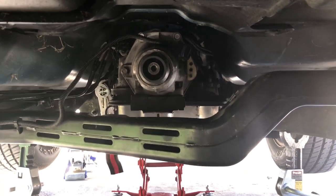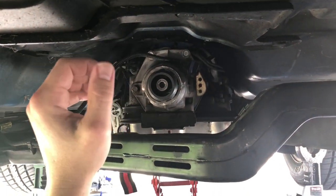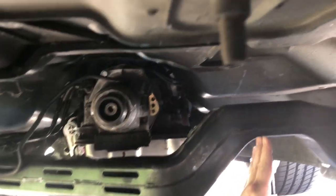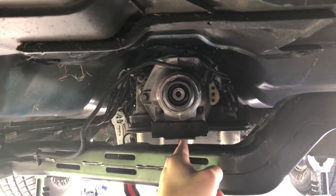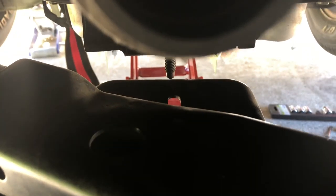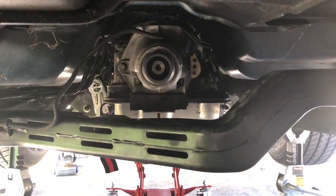My plan here is I've got my transmission sitting where I want it to sit. I've put the driveshaft in it. Everything lines up the way I want it to line up. So what I'm going to do to modify this: I think I'm going to cut it right here and then cut it right about here. I'm going to raise this center section up an inch and a half, which is where it needs to be. And at the same time, I'm going to shift it an inch and a quarter to get this factory bolt hole to line up with the bolt that's sticking out of the bottom of the transmission mount, because right now it's off by about an inch and a quarter.